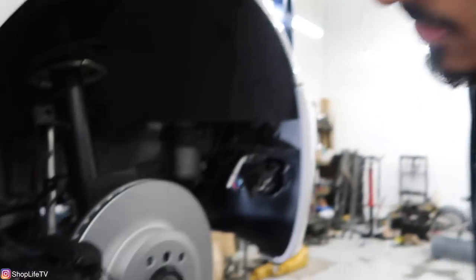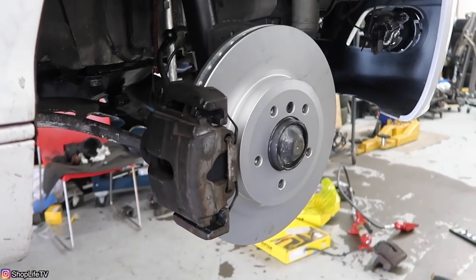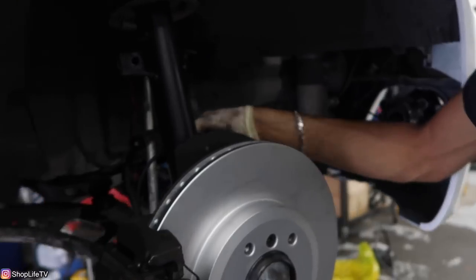The only difference between the passenger and the driver side is the driver side has the brake pad wear sensor. The wear sensor sits inside through this cavity inside the brake pad itself, so make sure you route that the same way the old one comes off. Besides that, just put this rubber grommet back into the bracket for the brake line and you're good to go. When you're bleeding the brakes it does help to have a power bleeder — we'll list everything you would need in that video. That's it for this video — it's a very easy brake upgrade and these brakes are significantly bigger and will improve your braking performance. Thanks for watching, feel free to leave a comment or message me on Instagram at shoplifetv.